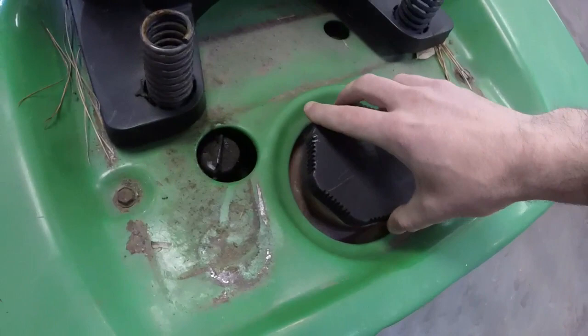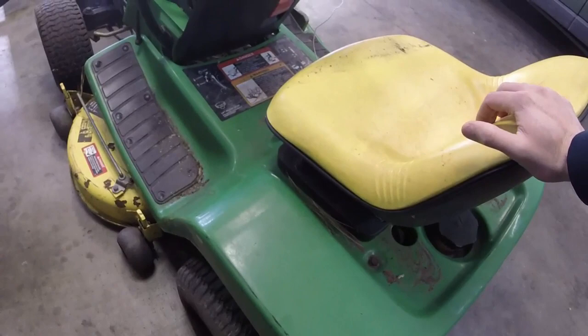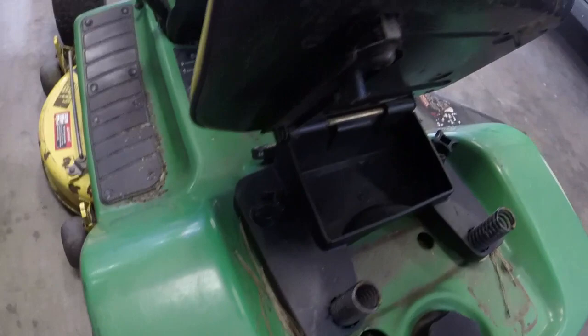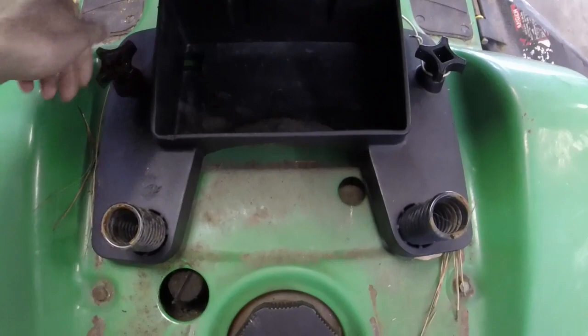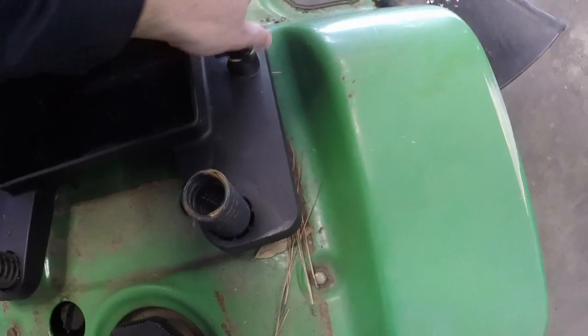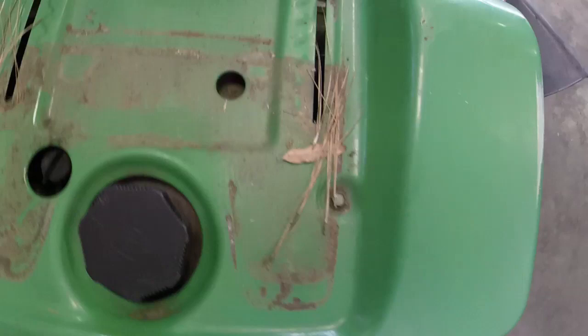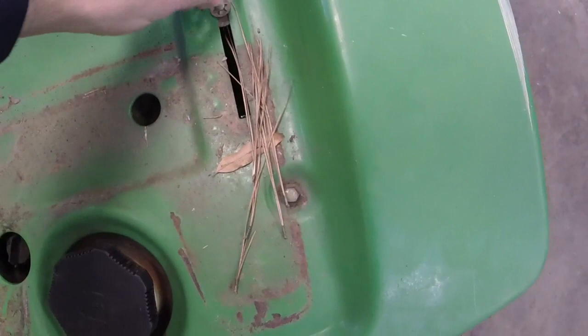While we're doing this, we're going to do the whole fuel system top to bottom, starting with the carburetor. So in order to get all that taken care of, we've got to get this off. And part of that requires getting the seat mechanism off here, which shouldn't be too difficult because I think it's just these two wing nuts that I already had most of the way off here. So we'll take those off. This should lift the seat off, and we're already a decent portion of the way there. So these are attached to the fender. They're not attached anywhere else. Looks like we've got, what would that be, half inch?